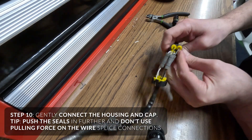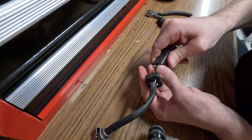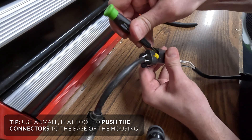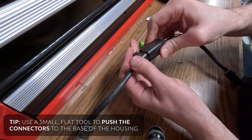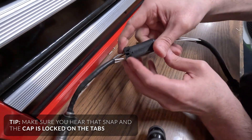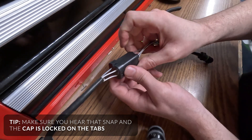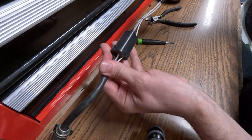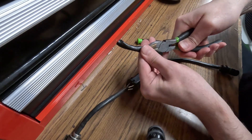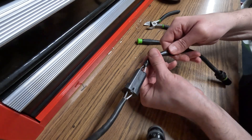Pull it and make sure these seat. It helps to push in here so you put less tension on the wire itself. I'm pushing these down so I don't have to use the wire for tension, making sure that they seat in there correctly before I shut it. Locks in on each side. You could also cut the sheathing down the side and just rewrap it. Use high-temp electrical tape. That one's good to go.